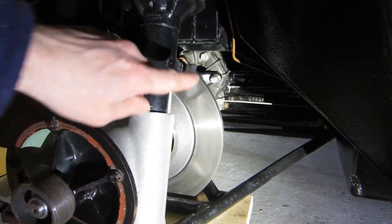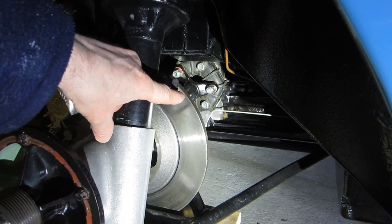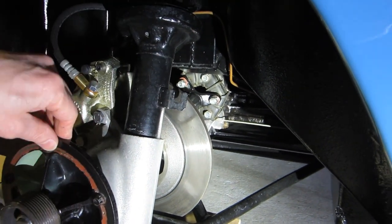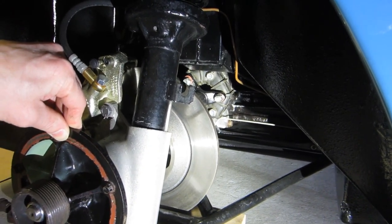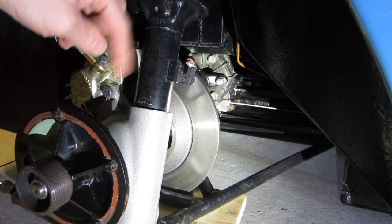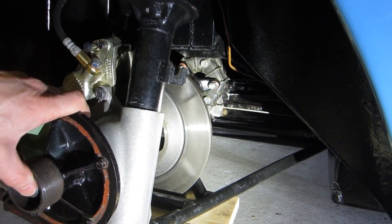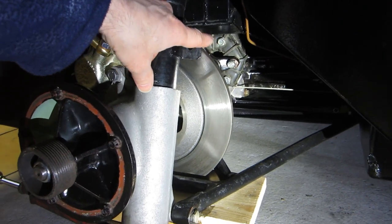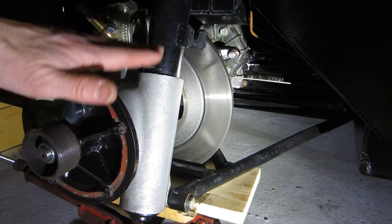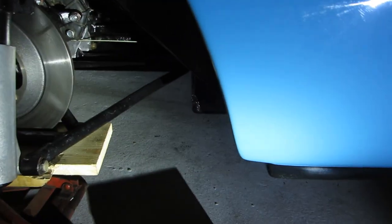Just in case you're not familiar with it, those are the doughnuts — the rubber couplings in the drive shaft. There are two of them on this original drive shaft. Lots of Elans have been converted to either only have one or even CV joints at both ends of the little half shaft. That's the bit I'm avoiding stressing by preventing the wheel from fully drooping. If you jack the car up on the body, which was the original position, the suspension would of course fully droop.